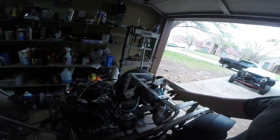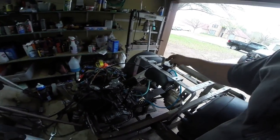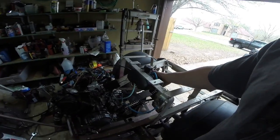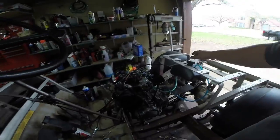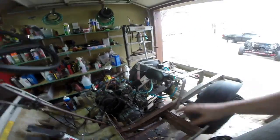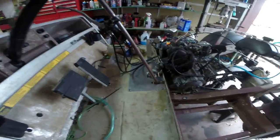You can see it fires up completely cold like a champ. I had this thing running really well before we pulled everything apart. The other thing I did was take the jets out of the old carburetor and put them in the new carburetor — that's another reason these things are running a hell of a lot better. Here's our revised fuel system: just bent up some aluminum brackets. The gas tank is nicely fixated, won't vibrate too much, and once we fill it with gas it'll drain down into the carburetor. All that's in good operational order.